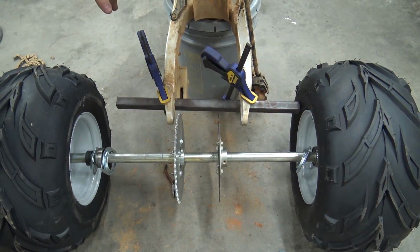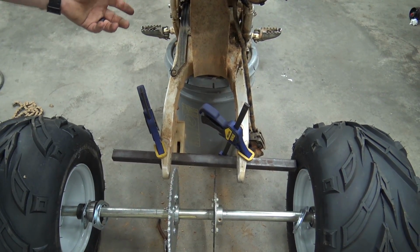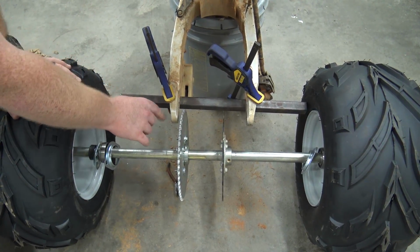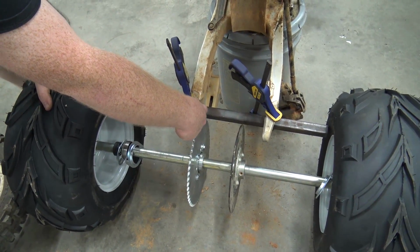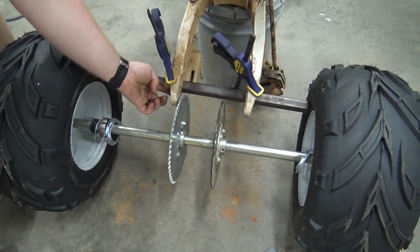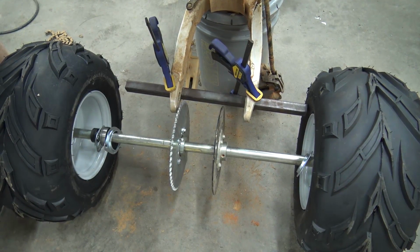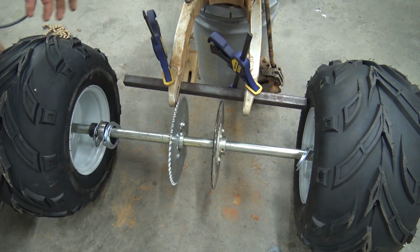What's cool is the CR80 uses 420 chain, so I'm going to have Go Power Sports send me some DID chain, which is motocross chain, slap a good run of DID on it, and I'll still be able to use the factory adjustments, because I'm going to weld 1/4 inch thick ears that come up, and basically this piece of metal will slide and be guided by the bottom of this swing arm. That gives me about 2.5 inches of adjustability, and I can buy a motocross chain later that's an O-ring chain, which I probably will.